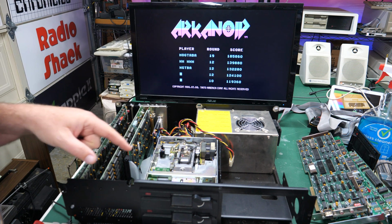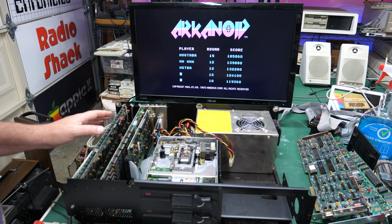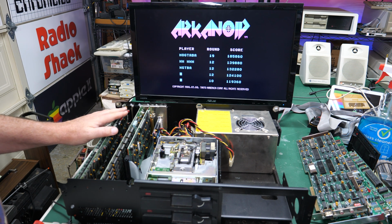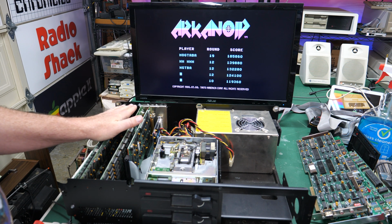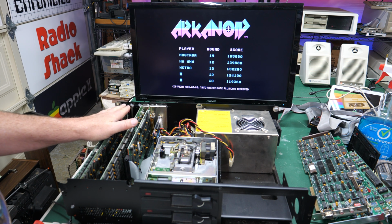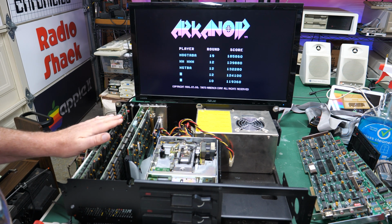We'll go in and take care of that, but everything else just works, and I couldn't be more tickled to have this cool and rare video card, this Paradise video card, the first one they ever made. It does get quite a bit warm, I notice, as I'm tapping it here. So this isn't something that you want to leave on all night, I don't think, after it's been sitting around for 40 years.